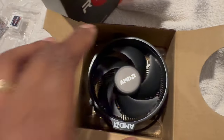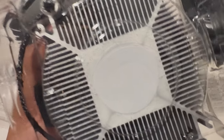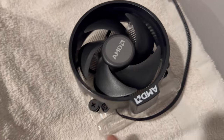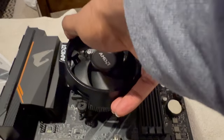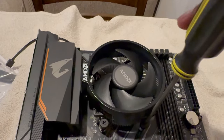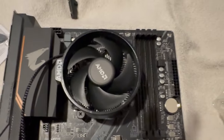Next step is to always put the cooler on. In this case I don't have a big water cool kit — instead I have this little radiator fan that comes with this specific kit, so you don't have to buy an extra one. One thing to note: on the bottom there's thermal paste that sticks between the cooler and the CPU — do not touch this with your hands. Before I put these on, I need to first remove the case holder screws. There are four of them and they're going to line up with the four screws on the CPU cooler.